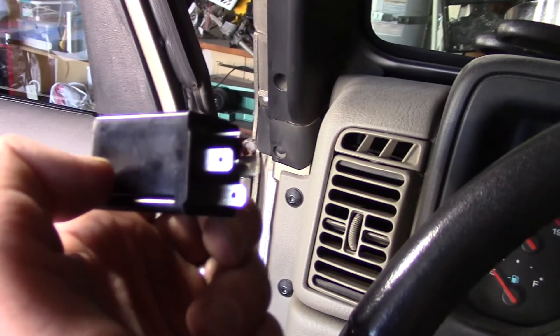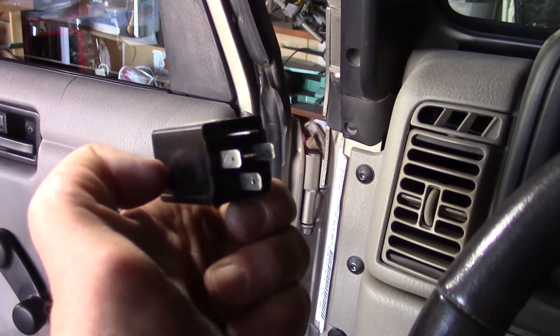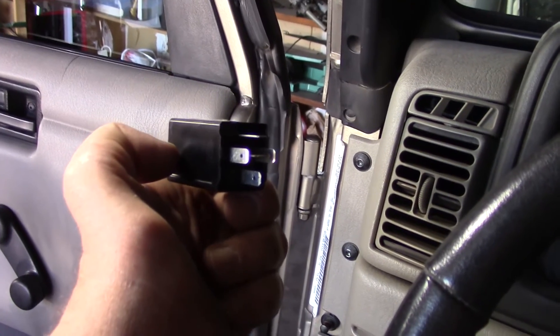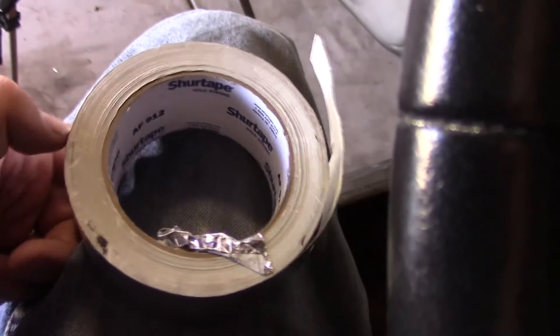Here's my flasher. The way mine came out, the flat plug was on top. It's kind of funny because when I went to even touch this thing it almost fell out without any pressure. So I'm going to reseat that thing and put a little piece of tape on to hold it in and see if it works.